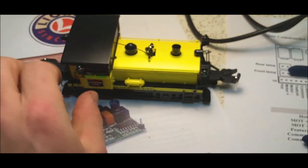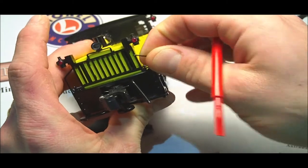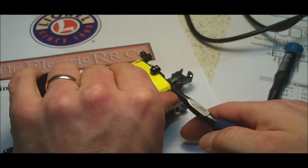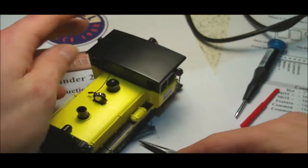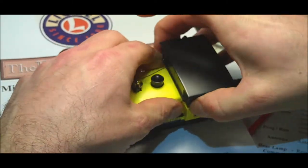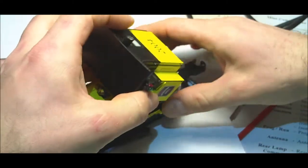Okay, so you have the four screws removed and then you're not done. You have to actually pull these rails out here, and then to get this hood off you have to push and pull these little guys out. Grab these very gingerly and pull them out this way, then use little pliers to give this rod a little pull. Pull those two rods forward and that allows this to lift off — make sure you didn't forget any screws. And it slides forward and comes off.